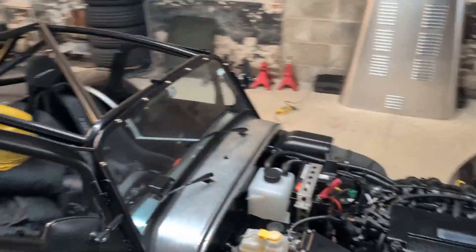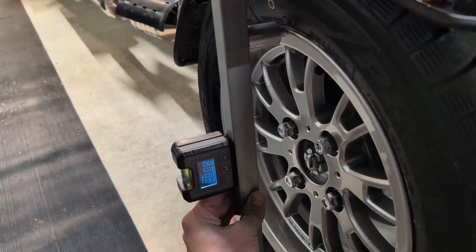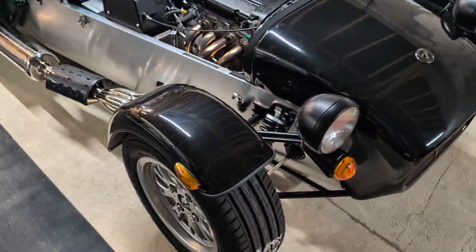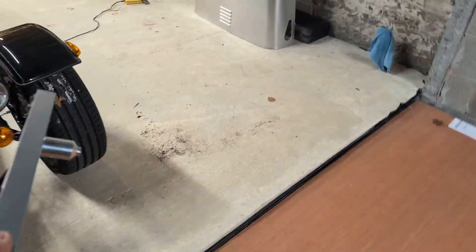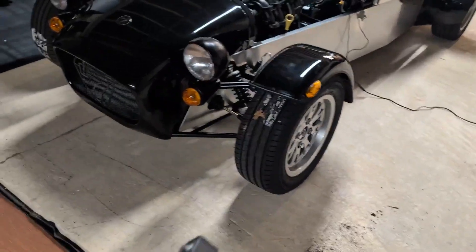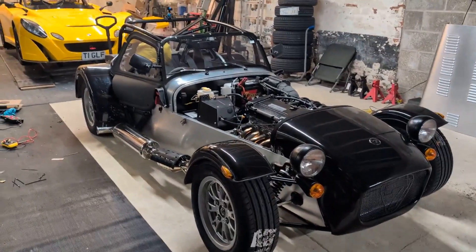The first thing I'm going to do - I've got the ballast back in the car and I've got repeatable measurements now on the front wheel cambers. I seem to think people aim for 2.5 degrees negative at the front. This front corner is bang on 2.5 but I'm repeatedly getting measurements of 3.5 on this one, so I'm going to wind this one in a bit, get it a little bit closer.